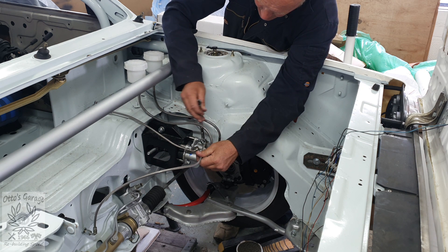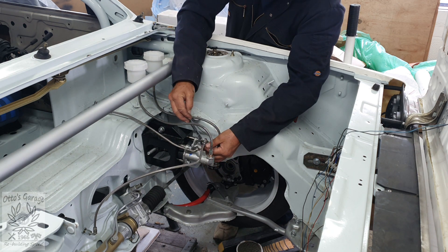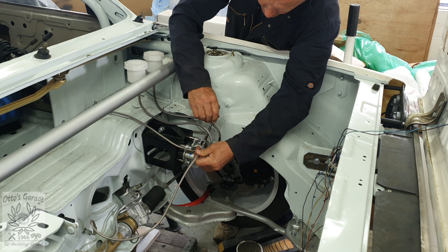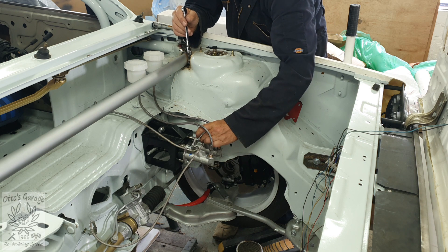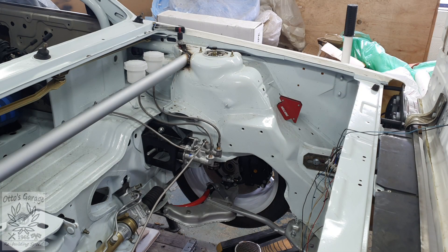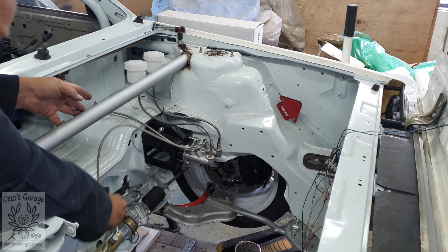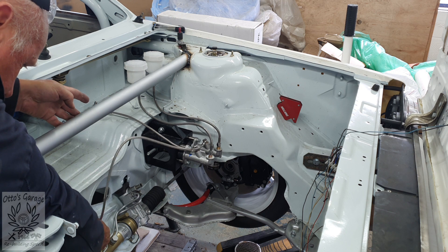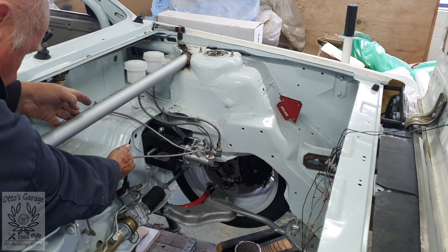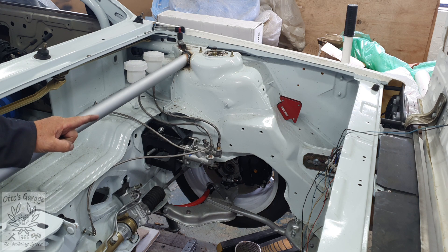We'll connect that up to the master cylinder. If there is a super kink in it I can just take the banjo bolt out and flip this one around, so we can do it from both ends. You can see now as you're turning it, it's just wanting to twist it - so it's gripping. I may well have to loosen something off here to get it right. I've tightened it up onto the banjo bolt - although it's loose, the fitting is tight, so I need to tighten the banjo bolt up afterwards. Then we'll route that around later and get it clipped in the right place. I'm going to tighten this one now because we know it's in a good position, and then tighten the banjo bolt over there.